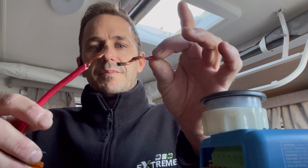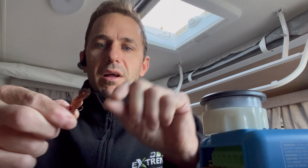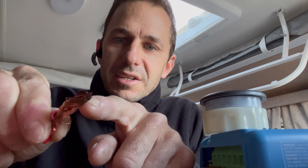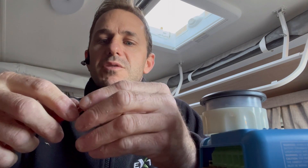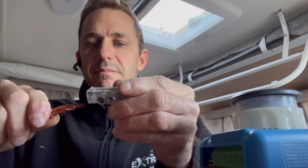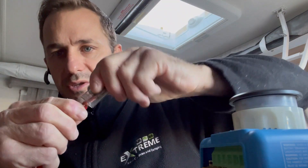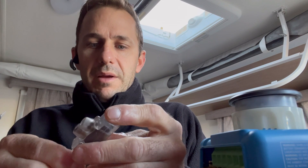This is the other end of it — you can see what they've done, they've just kind of twisted it, and it's getting hot. It's horrible, it's not making contact. They've just kind of twisted it like this and gone — let's quickly join the cable, grab this out of the tub, in she goes, wind your flathead screws in, away you go. But if you can see the surface area — that screw wound down — the contact area is just not there. If they'd put a ferrule on that, that would be much better and probably wouldn't have had this issue.